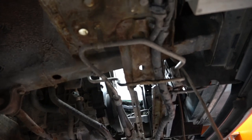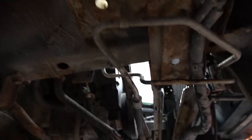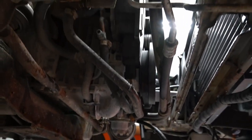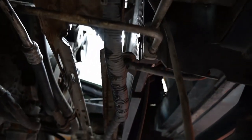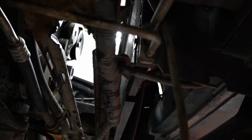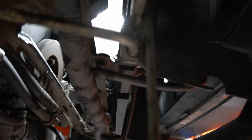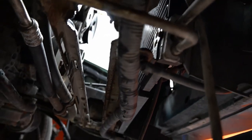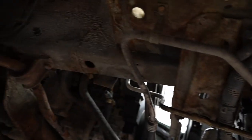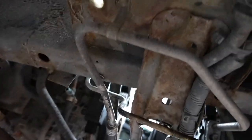Okay, so it turns out I can't film this. It is just way too tight. Anyway, you can see the pipes coming here, and then they go underneath the frame, do a turn, and go into the radiator right there. So we're going to remove these two first. They're sitting with a hex, probably a 6mm hex in the middle there. Remove that, remove the clamp, and then you can pull the pipes out. And we'll also have one fitting up here, which is like a 10mm screw. Get that out.